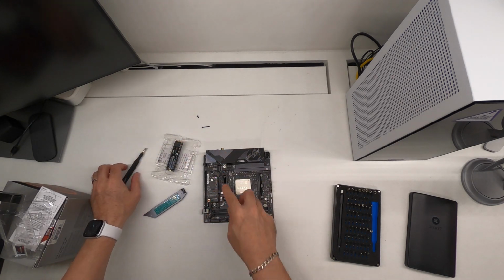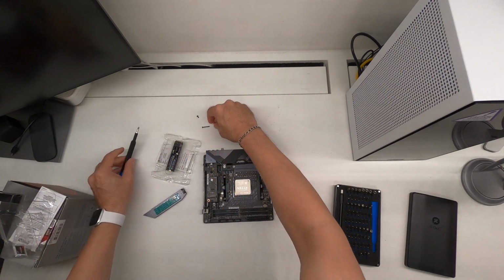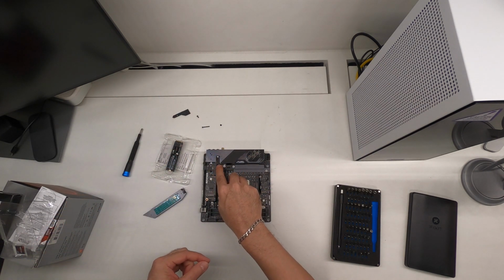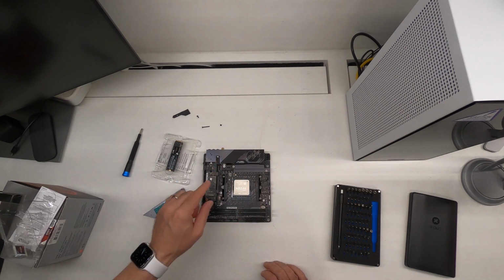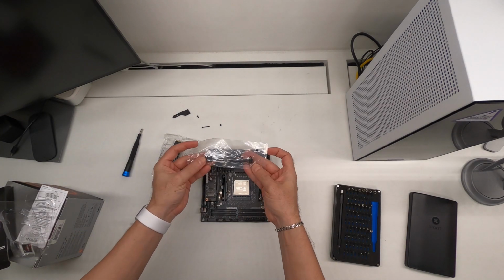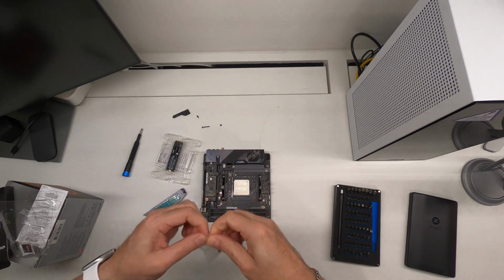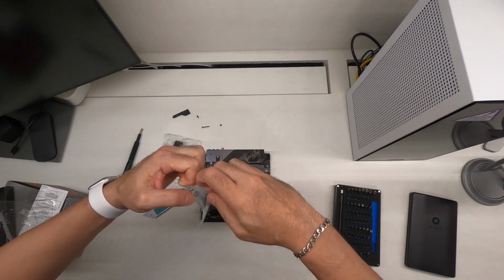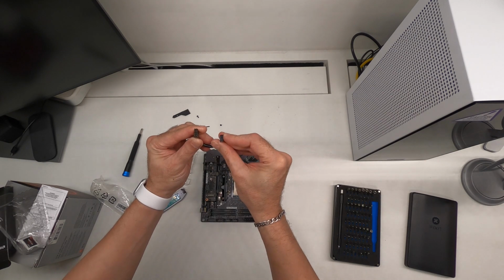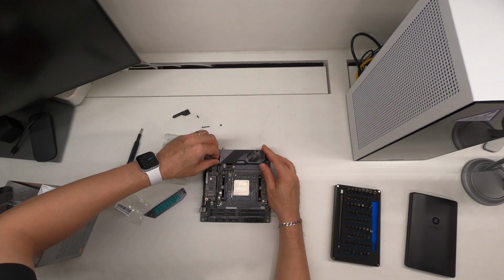In my previous video I did miss adding the HD audio connection, so let's do that in this one. Take off this connector here, and then there is a small HD audio connector there. It looks very similar to the large one, but in fact it's actually quite a bit smaller. There's an adapter, so I'll get that added right away. And that's the adapter. As you can see, the normal size is that big and it becomes this small. Not much of a saving, but Asus did that in the ITX board. So this would actually hook up to this connector here.